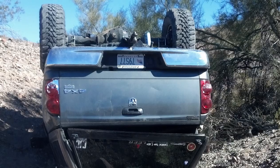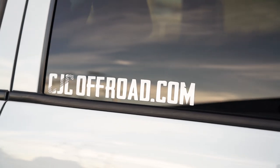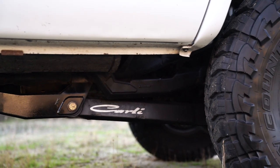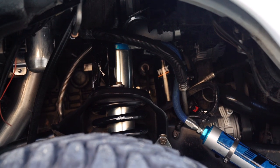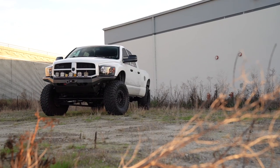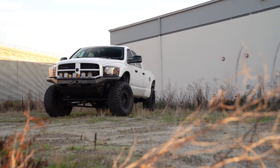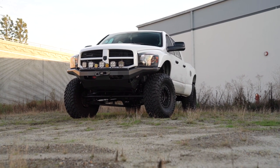I'm running 4.56 gears. I like them. Some people will say that it's a little too much gear, but most of my driving is off-road or towing a really heavy trailer, so it works out well for me. If I was going to be just running high speed in some of these states where you can run 80, 85 miles an hour down the highway for hours on end, I might have went with 4.30s with my 37s, but this gives me the option to run 40s — I have run 40s on this truck. If you guys have any other questions, please put them down in the comments. Like and subscribe to our channel, and thank you for watching.